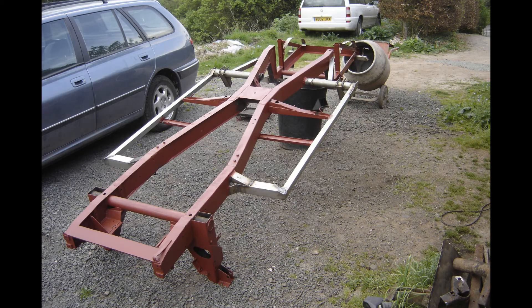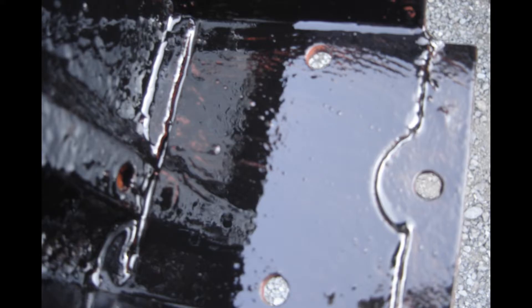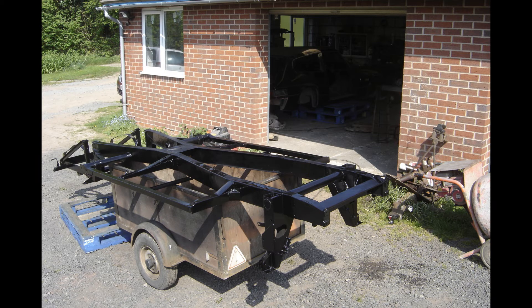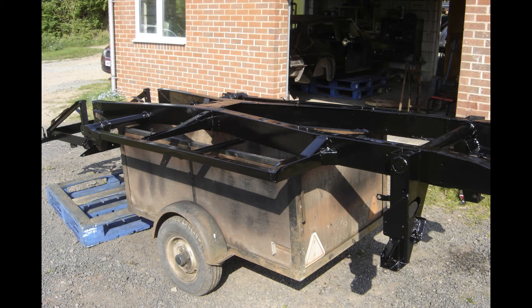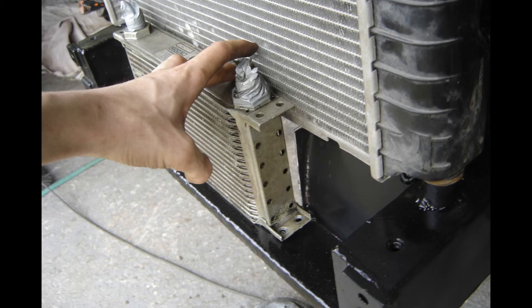The stainless is left bare for now, and there's another photo with the engine waiting in the wings in the Omega behind. I then tried Rust Hammerite — brushing it, considering it's meant to be brushed, is absolutely useless. I got very frustrated with it and resorted to thinning it down and spraying it, and I cannot sing its praises enough. It sprayed onto the chassis absolutely brilliantly; I got two or three layers on there. Ten years down the line it is still in really good shape under the car — it's always been outside — and the chassis is in fantastic shape. The 19-row cooler sits in front of and below the radiator, and you can see air will flow through both independently because of that cutout.